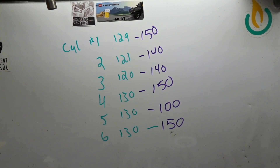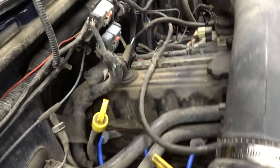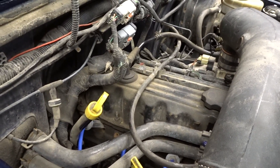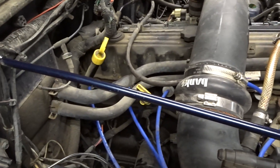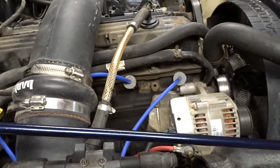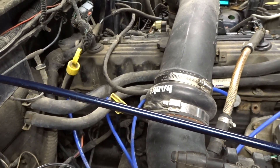Still processing the readings from four years ago to today. Right now, cylinder number five is reading 100 PSI — that's a problem. I wonder how much it would cost to get the head done, buy a set of rings, an oil pump, and throw it in. I'd have to pull one of the journals off the crank and inspect it. A V8 swap including buying the engine would probably be close to 10 grand, not including axles — not in this budget.